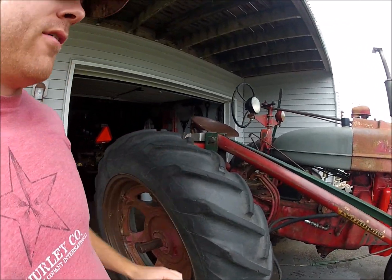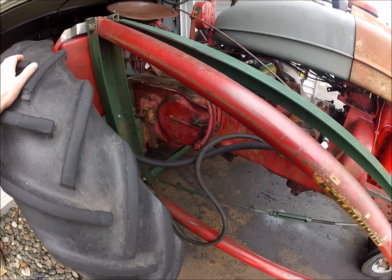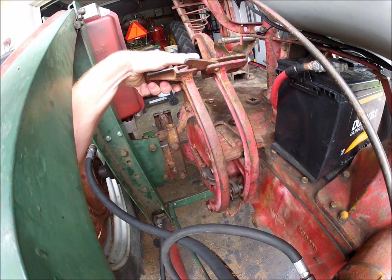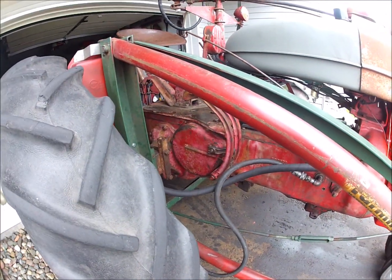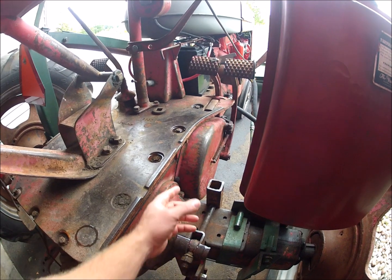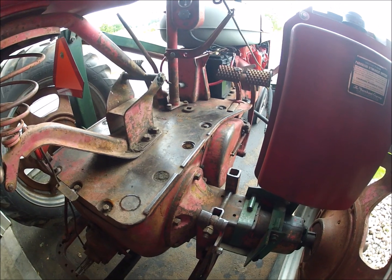I had to get things back together pretty quickly because somebody called and needed a little assistance, so it's a day later. I got the brakes back together and got them adjusted about as good as I think I can get — about an inch of play before it makes contact inside there. It turned out to be quite a project because I did have to remove the hitch assembly so the drum could slide all the way out beyond the rotor, but I got it all together. I haven't tested the brakes yet, but I'm confident they work.